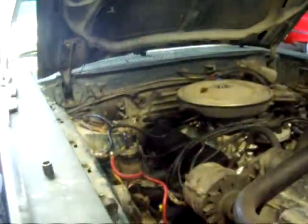I've got the torque converter nuts off and a couple of the bell housing bolts off. I think there's a couple left — only like two on top. Got the nuts off the transmission mount back there, so now all that's left is take a couple of little bolts out and drop her down. She should be ready to go.